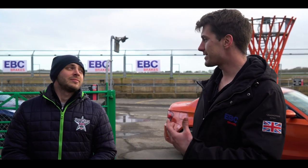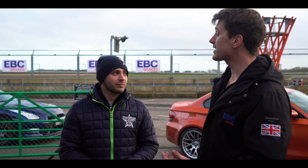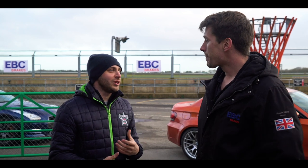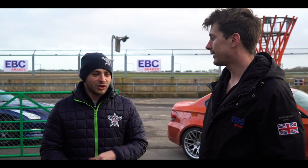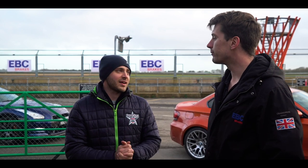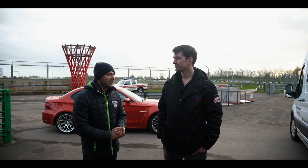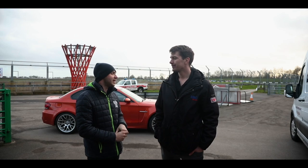And obviously you've got the grooves in the face of the disc, which help the cooling a bit as well. It's a more track-focused brake disc. So that's a very positive review then. Absolutely. Although I'm doing the day with you, it is my complete honest view of the pad. You do get a slight vibration sense from the grooves in the disc. You can feel that it's really venting as you're under hard braking. But from a performance point of view, there was no drop in that 10 lap period.